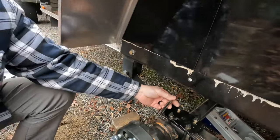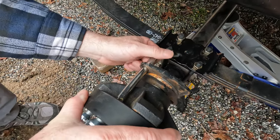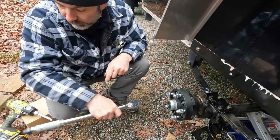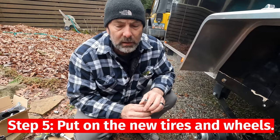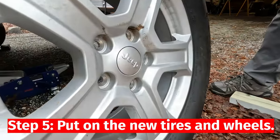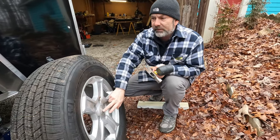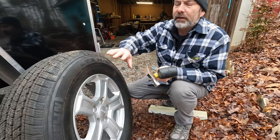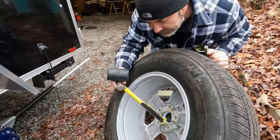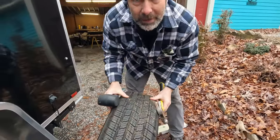To keep the wheel from spinning while torquing, we used a three-eighths inch extension pushed up against it to get the leverage needed to torque all the way around. Now that the spacer is torqued up, we put the wheel on and torque that down too. These are Jeep wheels off a 2018 Jeep. We're popping the Jeep center cap out to make sure it's not interfering with anything — just a quick tap with a blunt piece and it pops right out. We can pop it back in afterward if needed.